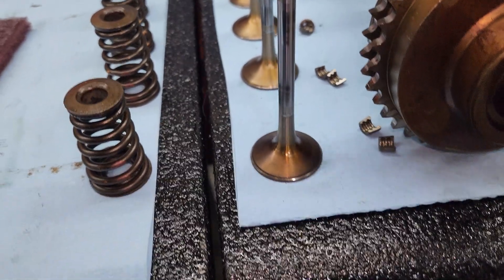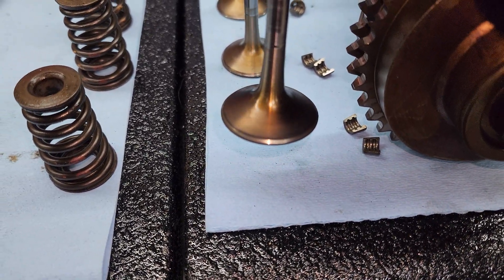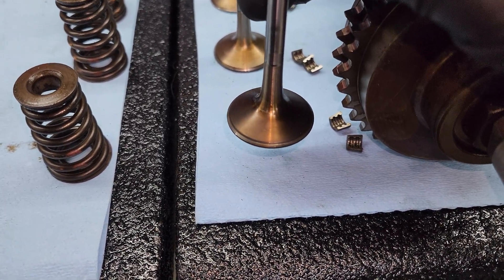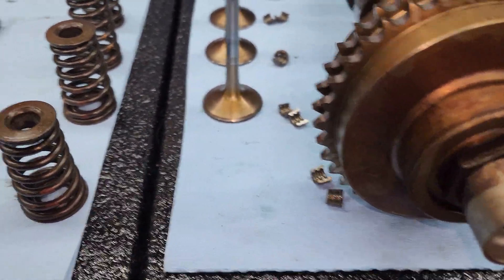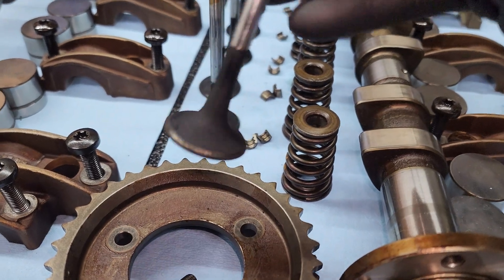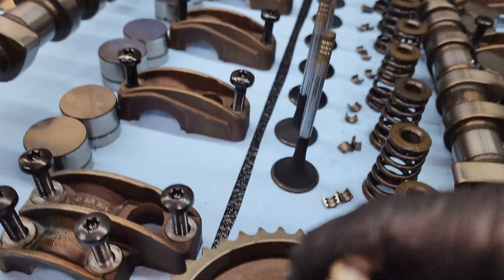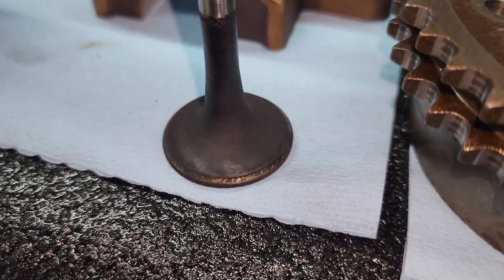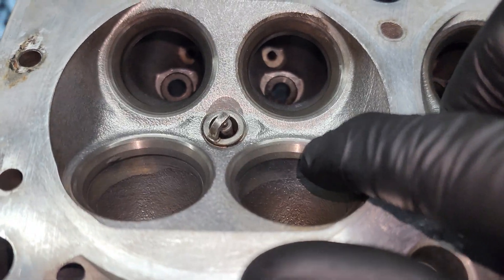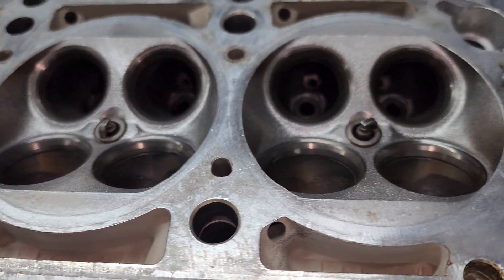Here is the very first valve - I kept them in order from front to back. You can see it's clean right there, and then you've got a little bit right here that looks like something might have been getting by. On the exhaust side you can see that side is pretty dirty right there on the valve seat. The head cleaned up really well from the cleaners, even the exhaust side cleaned up really well, so mainly we're doing this for the valves themselves.